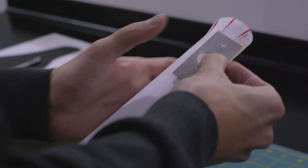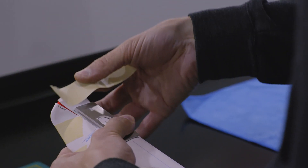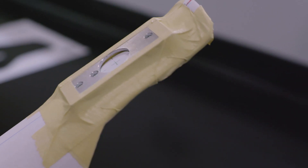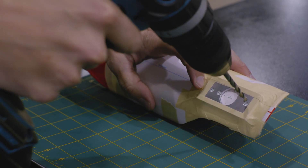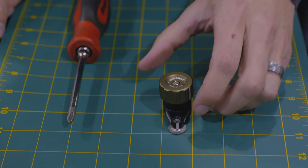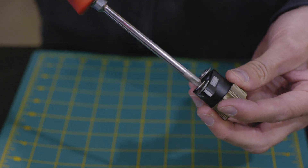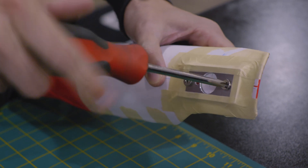With the template firmly secured, we can now mount the aluminum drill guide. Carefully align it with the template. Once in place, tightly secure it on all four sides using the same high-quality masking tape as before. It's very important that the drill guide is mounted as accurately and firmly as possible. Next, using a 3/16 inch drill bit, drill the three small holes through the drill guide and the fork guard. After this, we'll temporarily install the two 3mm Phillips head housing screws into the drill guide. These will help to hold the drill guide in place as we drill the large hole.